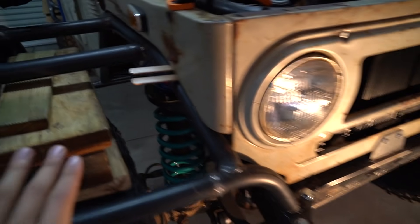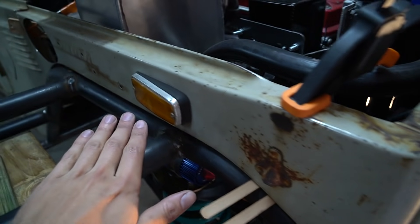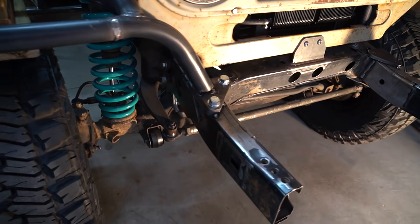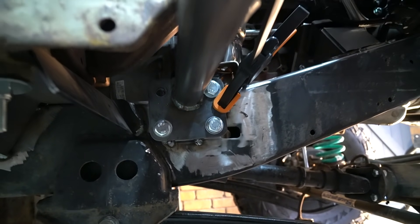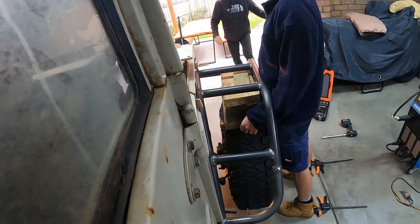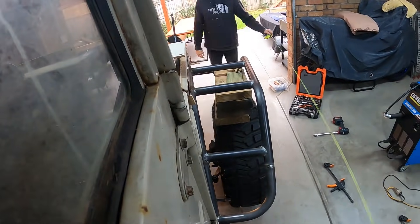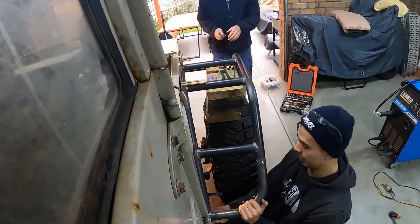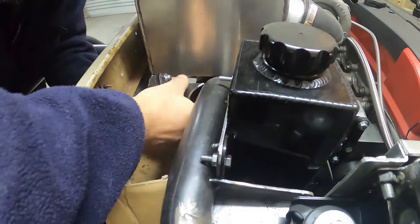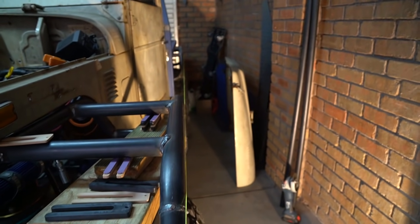Front guard being installed today — these are actually really tricky to get right. I've got my mate Max here helping me and this is definitely a two-person job. We're just trying to pack it up and clamp it. There's going to be a 3mm sheet of alloy on top, so we're just trying to get all the fitment right. We've got mounting tabs at the front which we'll tack to, and plates at the rear as well — four M14s in total at the rear, two at the front. Get window packers, people — this job would be almost impossible without them. 1900 dead.